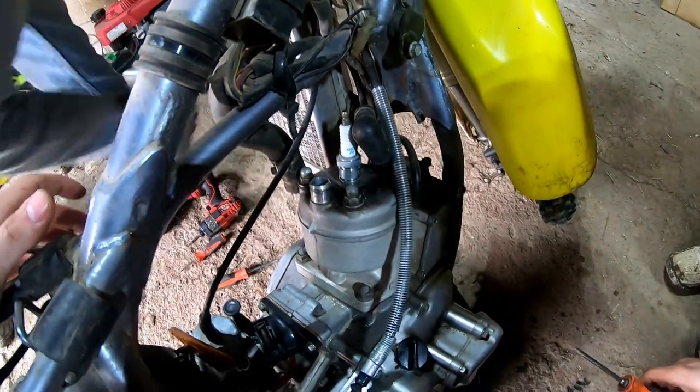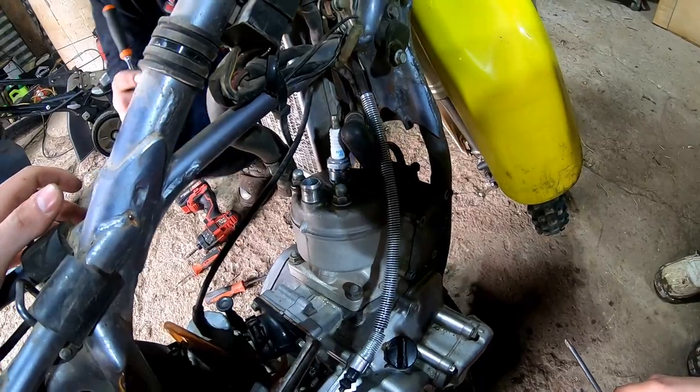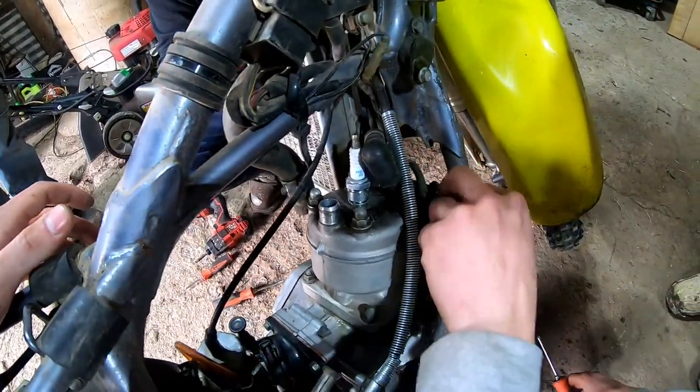We're probably gonna pull the motor and do seals and all that stuff. Right now we're just kind of seeing what we need to order, seeing what happened, where it's stuck — if it's stuck at the bottom or stuck at the top. That'll kind of lean us towards what happened. Make sure the crank — these 85s had issues with rod bearings, so it's definitely not out of the question.